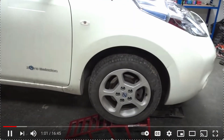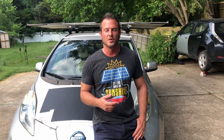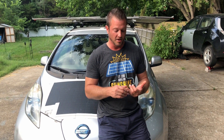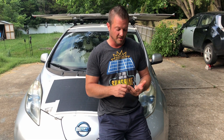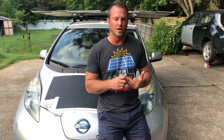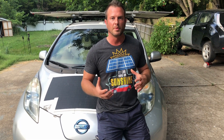I'm always very grateful for his input on my projects, even when it's 'Sam, you really shouldn't do it that way.' So that's the story of my 24-kilowatt-hour battery swap and the three considerations I thought you, the viewers, should know if you're considering doing one: the battery's tendency to skid off the jack, the brackets you have to have if you're doing a direct swap, and the incredible ease that the latest version of LeafSpy Pro brings to this battery swap.